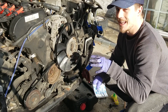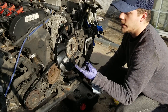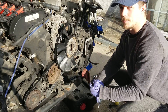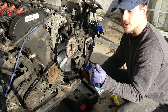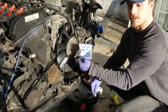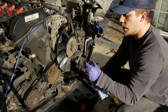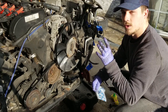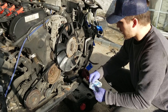The time-lapse ended at night — I had some issues getting the thing plugged back in. Two things to know: one, the temperature sensor doesn't have to be pushed in hard before you put the clip on — it just sits in there and the clip locks it in place. I was pushing it down too far, which was causing the clip to not actually lock onto the sensor. The quick-connect hose also has to be pushed in before it locks — push the clip in, slide it onto the cooling flange, and it'll click into place.